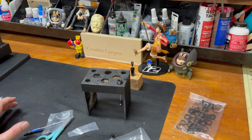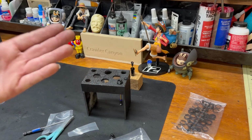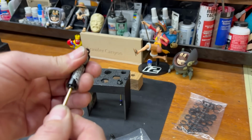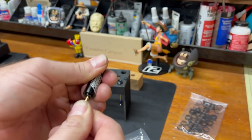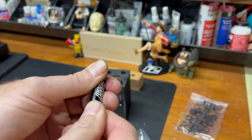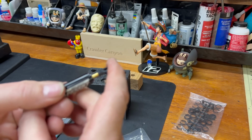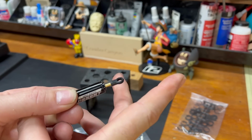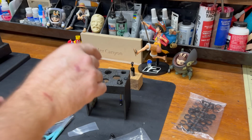You'll have effectively built a hydraulic piston. And a hydraulic piston works by differentiating pressure, by lowering and increasing pressure. We can't do that. This shock has air in it. The air is emulsified into the oil. That's why if we do this, the sound will actually change. And then when we cycle it, oh man, it's so good. What we're building here is not that.